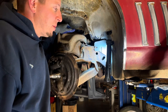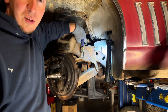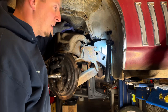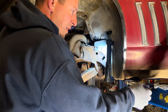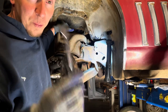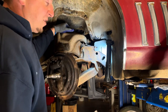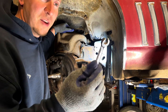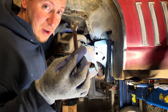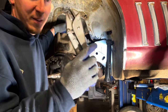So if a feller's doing a brake job, he goes and gets all his tools, and he comes to the time where he's got to take off these old steel lines that go into the rubber hoses here and here and same up on the master cylinder. He goes in his toolbox, and he gets this opening wrench. Nope, don't want that one. Wrong choice. So a smarter feller goes and grabs his line wrench, because that's what this is for, right? It's what you got, right? Wrong. Bad choice. The tool you really need is this.